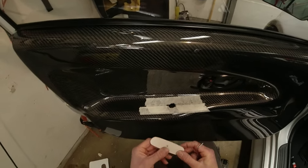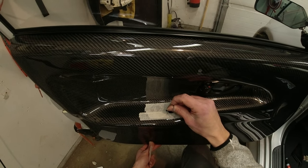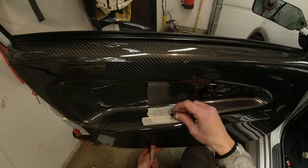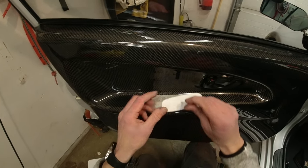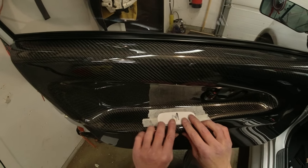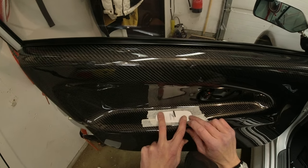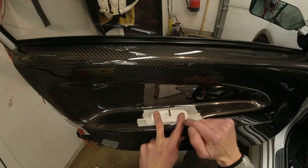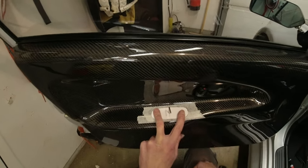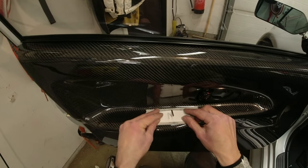The pilot hole is drilled, and dropping an allen key through it goes right through the hole in the middle of the bracket — pretty much bang on. I'll put the handle on there through the hole to get a rough idea of the shape we want, then draw around it and start cutting it out more properly. As it gets bigger we can make fine adjustments and work out how close we are to the sides.